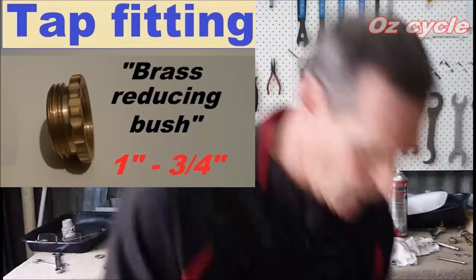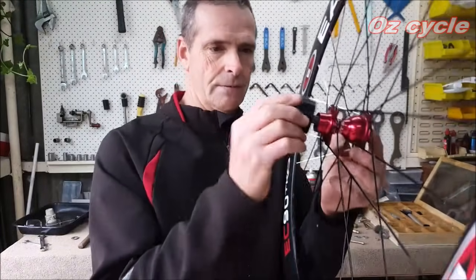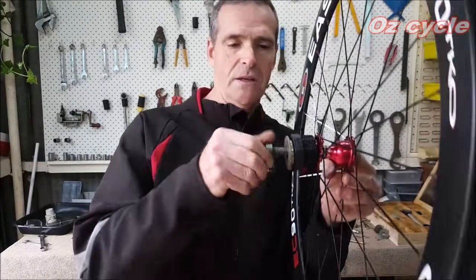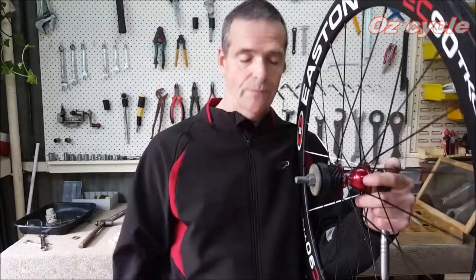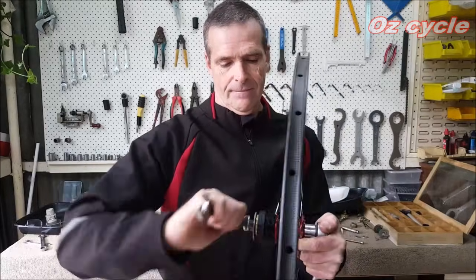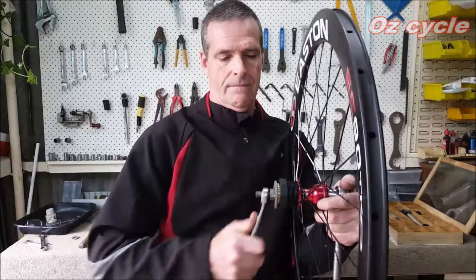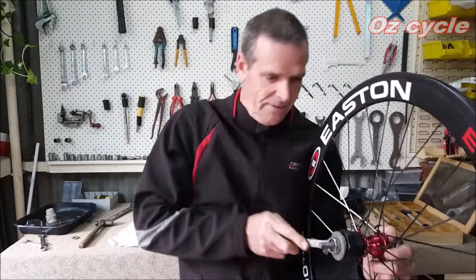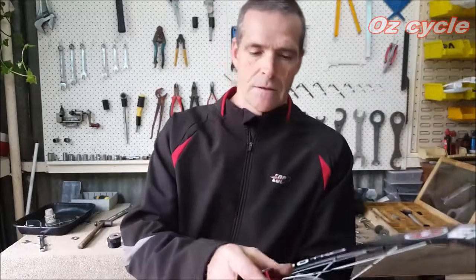Put the bolt in on the drive side and the non-drive side, get your plastic piece. This time use your brass piece — remember the brass thread — and screw it into the black piece. It doesn't have to be hard, just finger tight. Put a largish washer on — as long as it covers that brass bit — then the nut and wind it in. The brass piece keeps everything central so the bearing winds in nice and straight. You'll feel it seat — it's in place. Beautiful.